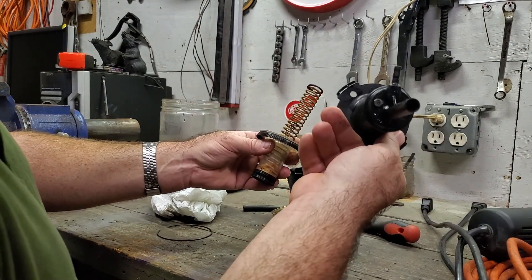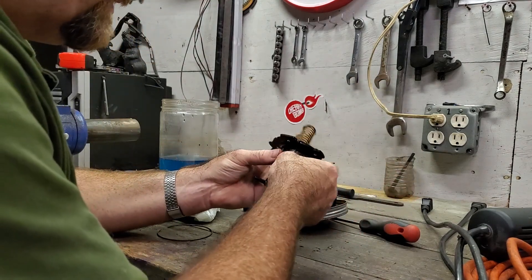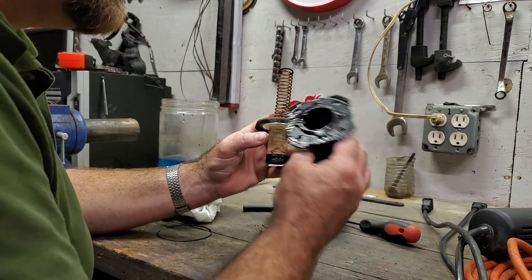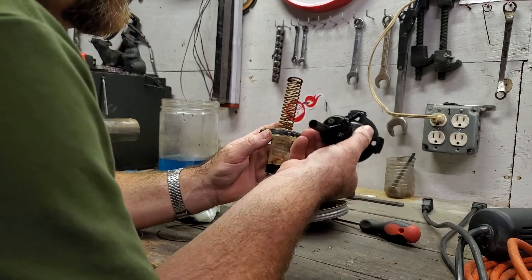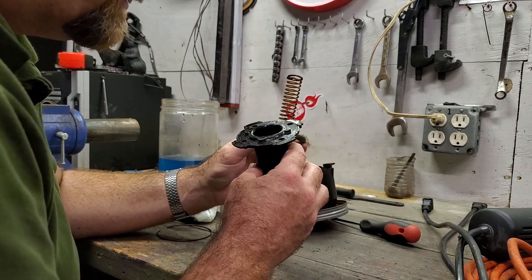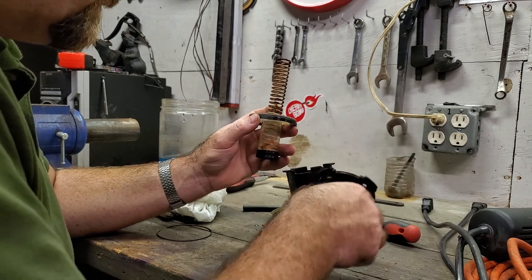The piece on the bottom just has two one-way valves on it which allow the fluid to be drawn up and then pumped out. That's a fairly standard arrangement. If you just undo the two brass nuts off the bottom it comes apart - it's just a couple of little spring-loaded valves like you'd find in anything of the era.